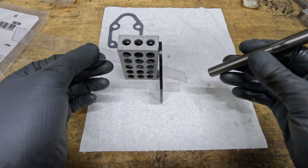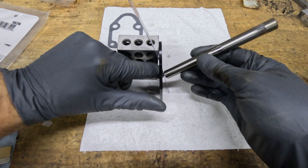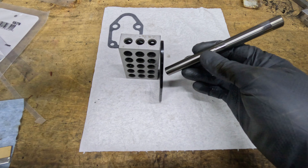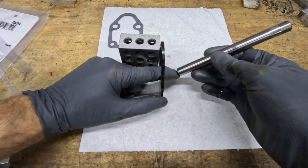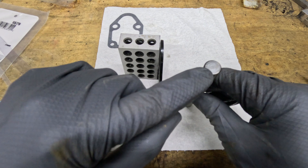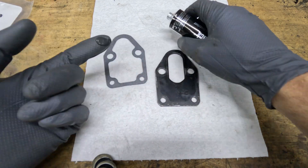I have a piece of plastic from a clamshell package. When I put this together, I'll place it down there so when I push the fuel pump in, I can get the pump arm behind the rod, slide it down, and it pushes the rod up. Then I just pull the plastic out and the pump arm and push rod are in contact - not stuck or wedged. Also remember which way the push rod came out - there's a distinct wear pattern; one end is the pump end, the other is the cam end.